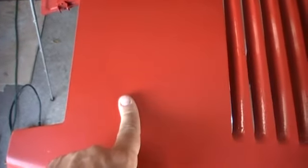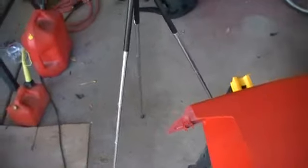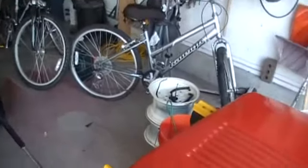So this is what it looks like after doing it — it's baby smooth after buffing. This is before the buff, just 2000 grit paper to cut the orange peel, and that's after. I don't know if you can see my hand, but here it's much glossier and it's real smooth. So I'll hit this again, and the more times I do it I'll bring it up to a fine, nice shine.